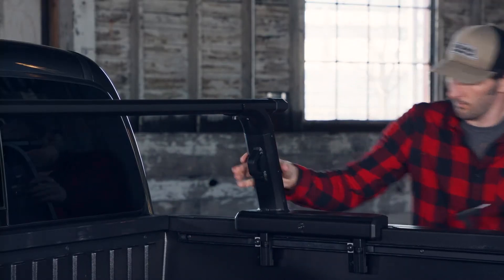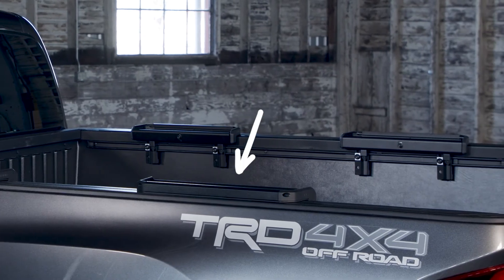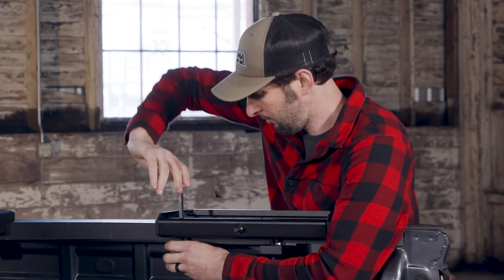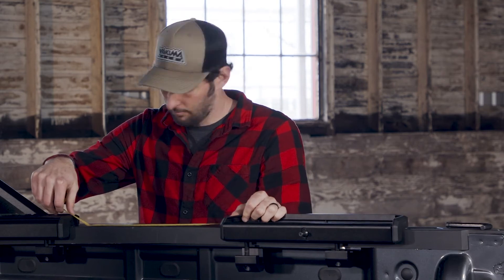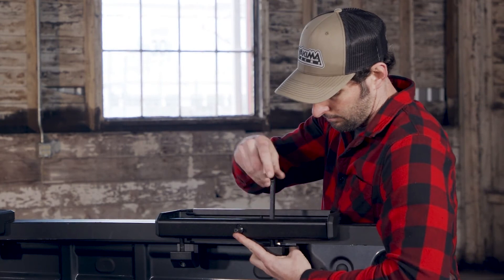Now repeat the process for the back of your bed. Clean the rail, locking base on driver side, non-locking on passenger side. Install the clamps. Measure from the ends of your front bases so they are equally spaced, making sure they are far enough apart to give you at least a 36-inch crossbar spread. Space the clamps as wide apart as possible, and tighten.